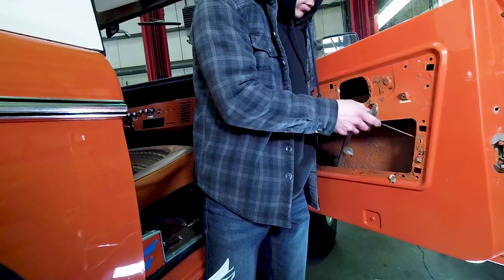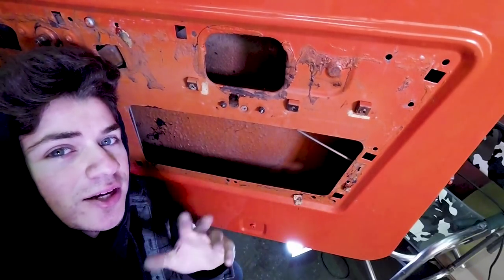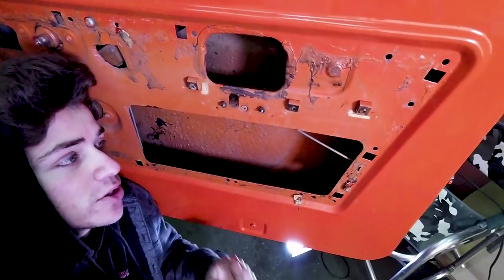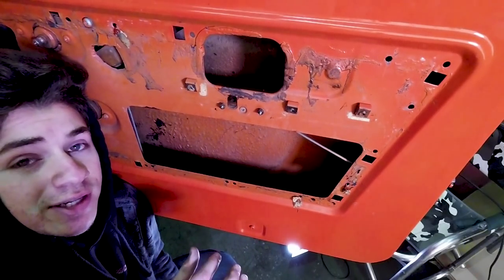After you've removed the track out of the door, you're gonna wanna unscrew the cap on the push lock and then reach into your door and unclip each of the rods. I can't really show you this, but there are 4 clips in here. You guys will figure it out just like I did. Just look for those clips, unclip them. They're basically like throttle linkage clips.